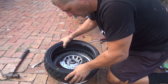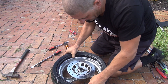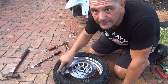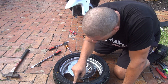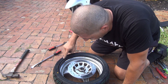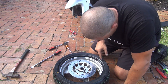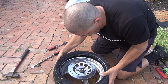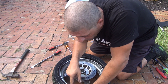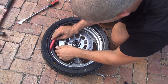Place the tire on top of the wheel and press one side in by pressing with two hands, left and right, until you feel it go in. Make sure the yellow mark on the tire is aligned where the valve is. Also confirm the rotation arrow on the tire is pointing in the correct direction of travel. Then use the rim guards so you don't damage the rim.